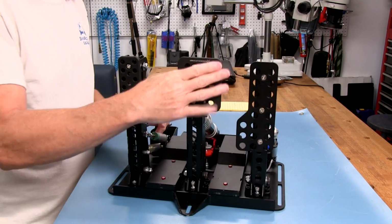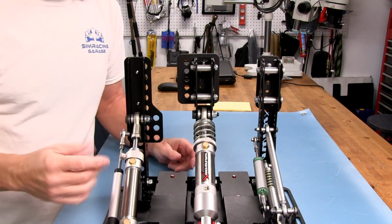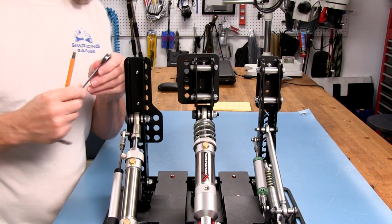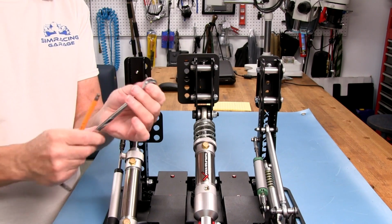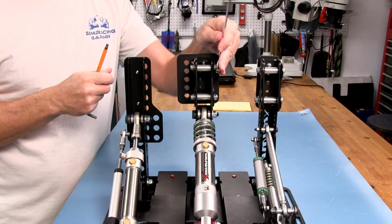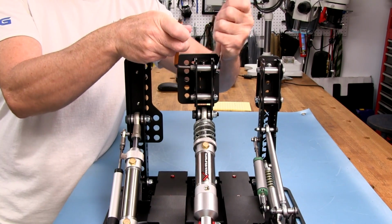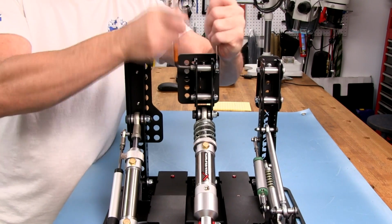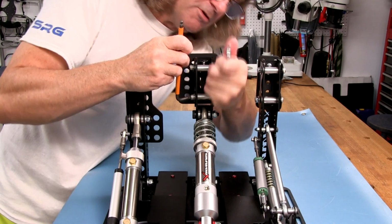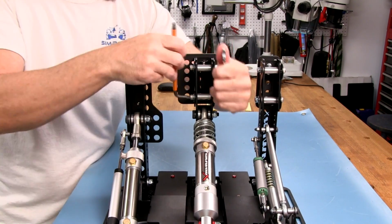So we can adjust the faceplate. We saw that. Let's turn it around and look at the way we can adjust the whole pad assembly. That requires loosening these two bolts here. Remember, this is one of the reasons why they gave you this nice 10 millimeter wrench that has a ratchet function in it. All you have to do is put it up here like this, make sure you're going the right way, and then you can just do both at once. It becomes a very quick action to loosen up these bolts. Very neat. If I can find the bolt, there it is. And very quick. Or you can just hold one and do the other one.